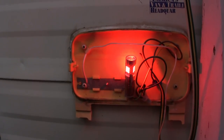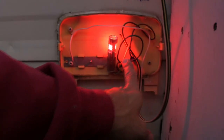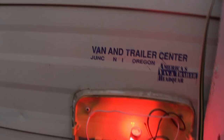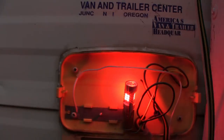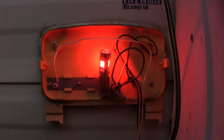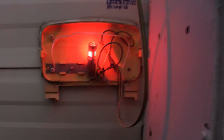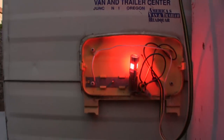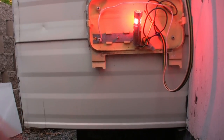Looking at this bulb up close you can see the three sides — there's one side here and one side here. Looking at this fixture straight from the back, it's actually not as bright as if the bulb were turned to look straight down the tube of that lensed section. In this case, because of the way it fits into the fixture, the light is going mostly to the left. Which isn't bad because when the cover goes back on, that's kind of the view you'd see from the side of the trailer anyway. But it shows this isn't an ideal bulb for this particular fixture since it's not omnidirectional.